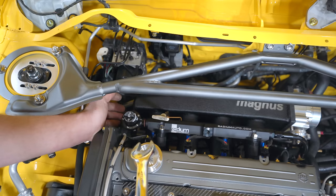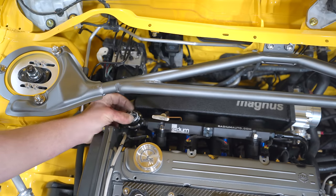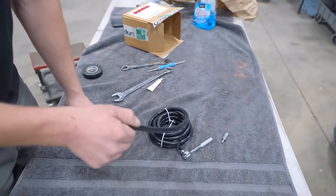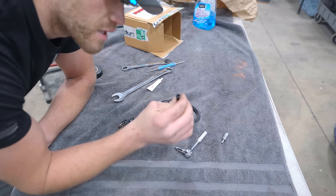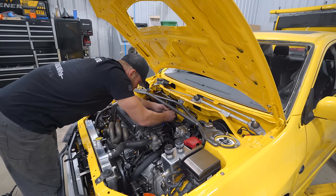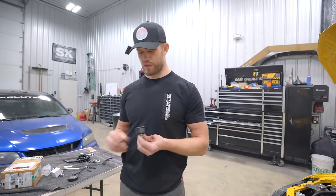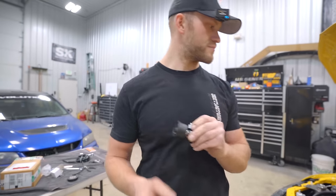So that's going to sit like that. The super nice thing is you can see when the fitting is tight - they are swivel fittings so you can still move it to wherever you need. I don't know what you guys use for vacuum line, but that thin, easy-to-tear thin wall stuff really sucks. I finally found some I think is going to be very good - surprisingly enough I got this on Amazon. A whole roll of quarter inch, ten feet, ten bucks - a dollar a foot and it's super thick, made by a company called Evil Energy. Also, this is an AN adapter for a quarter inch NPT, which happens to be a fuel pressure gauge fitting, so this is going in line on the feed side of the rail and now I have a proper place to mount our gauge.